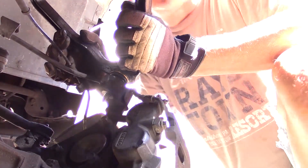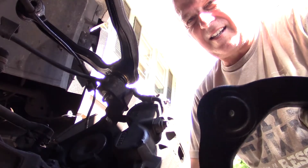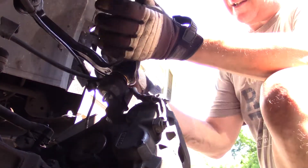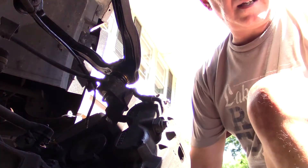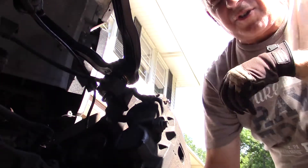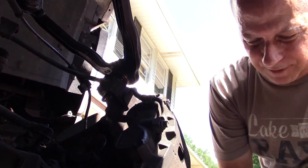It's one of their problem solvers. The one that was in the car had a grease fitting on it — I don't remember GM doing grease fittings too often, but apparently on this one they did. The original nut under here was a compression aircraft-type nut, and this new one is a castle nut — a little difference there, but not much.